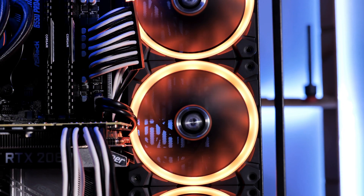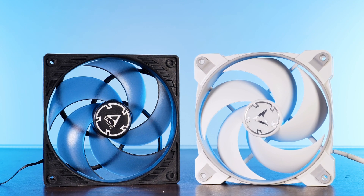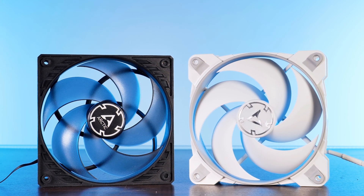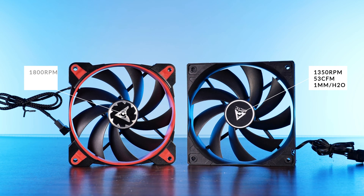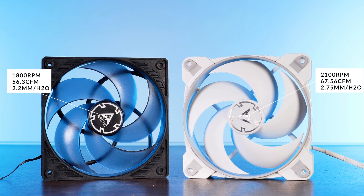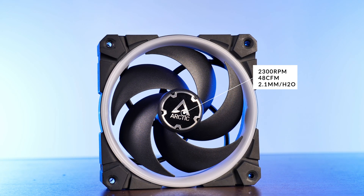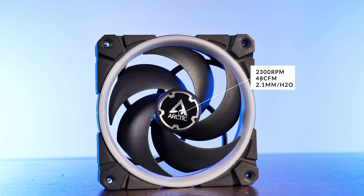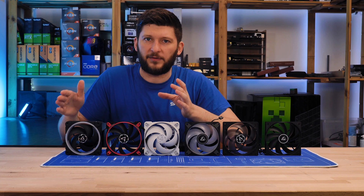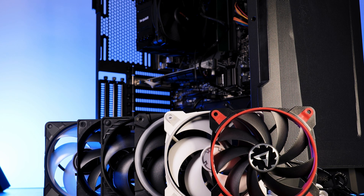The second big change from regular P's or F's to Bionix P's or F's is a whole ton of extra performance — steroids and cocaine, essentially. Although the blade areas look exactly like the regular counterpart, each fan is like the smaller one but on a tantrum. For the F-Series, we went from 1350 RPM up to 1800 RPM at 69 CFM at 2.1mm H2O. For the P-Series, from 1800 to 2100 RPM at 57.5 CFM and 2.75mm H2O. And for the ARGB series, from 2000 RPM to 2300 RPM at 48 CFM and 2.1mm H2O.